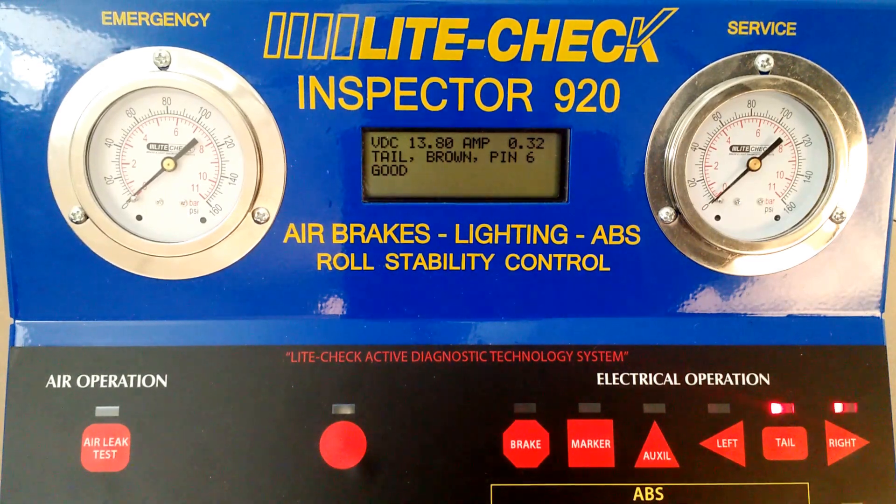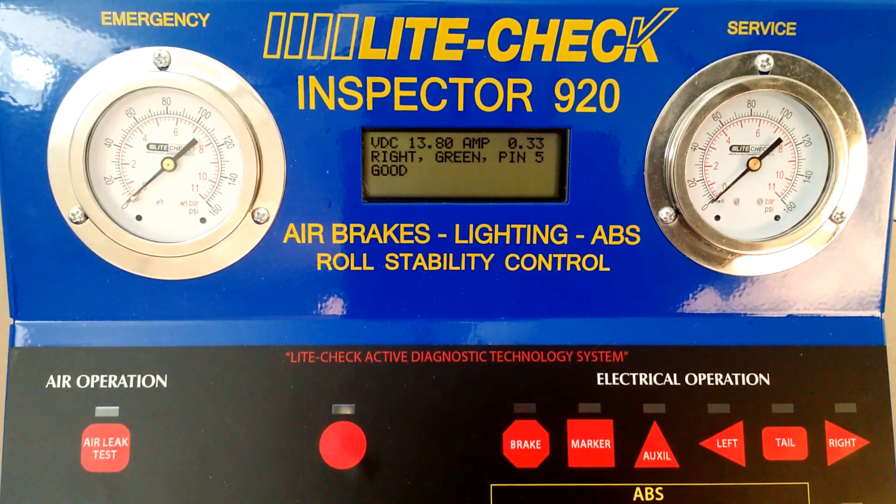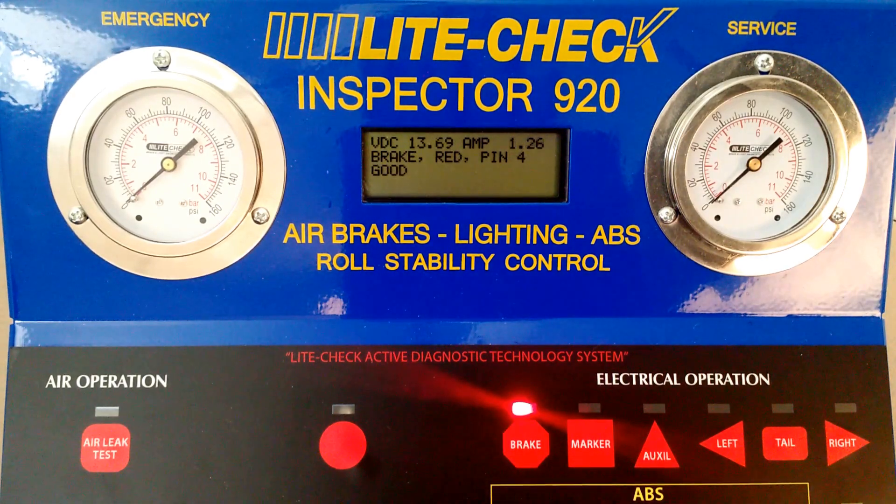The tester will sound an alarm with four distinct fault condition alarms: open, short, open ground, and chassis ground. The alarm will automatically quit whenever the fault is corrected. This will help you diagnose where in a line the fault has occurred. For example, say you have a brake line with a short. As you move up the line, you can agitate it until the alarm stops. That will help you identify where your short is.